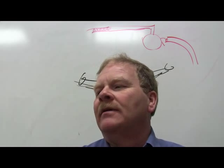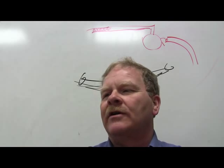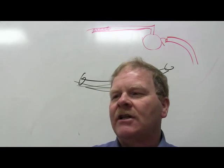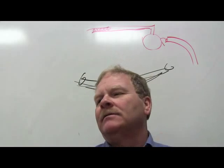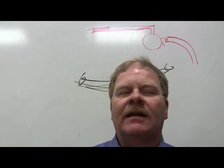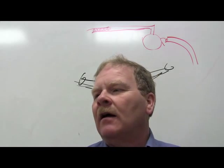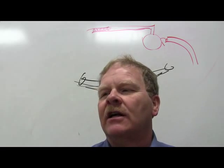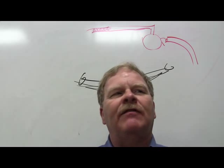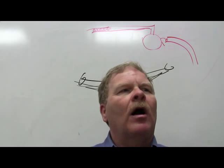The test drive route should include a dip and bump to check for bump steer, bottoming, and vehicle stability — sometimes when you hit a bump the car tries to pull. Also include right and left turns to check for steering return and body sway. Body sway should be neutralized by the sway bar. Driving a Volkswagen without a sway bar — the instructor swapped in the front axle from a '64 model — made it drive terribly until the sway bar was added, at which point it drove like a Porsche.